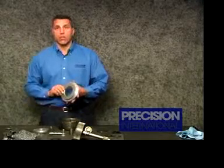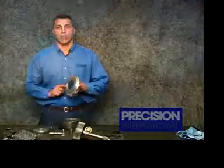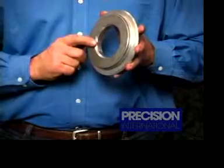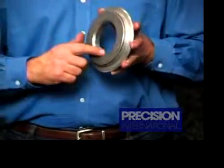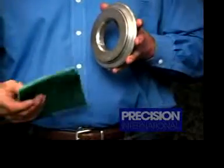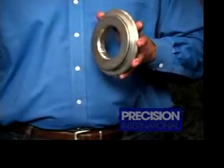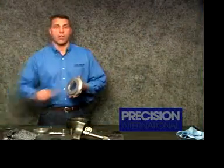Care should be taken when doing these overhauls. When the piston seal shrinks and we have the vehicle in the shop with a 2-3 shift concern, the seal surface area on the piston will become compromised from the piston itself rocking and hitting into the drum and scoring it. Upon reassembly, we need to address this area with a scotch-brite type product and 600 extra fine sandpaper to allow for long life of the seal.